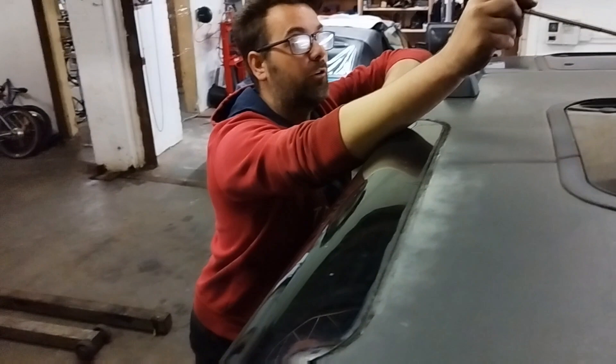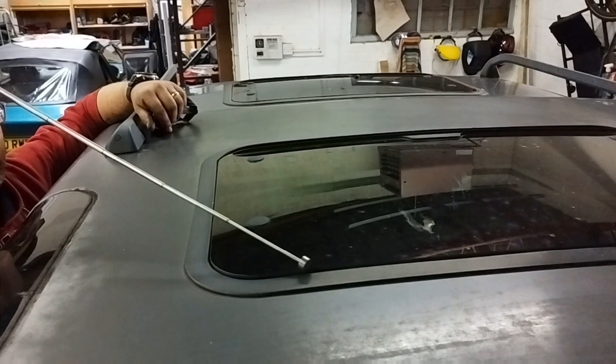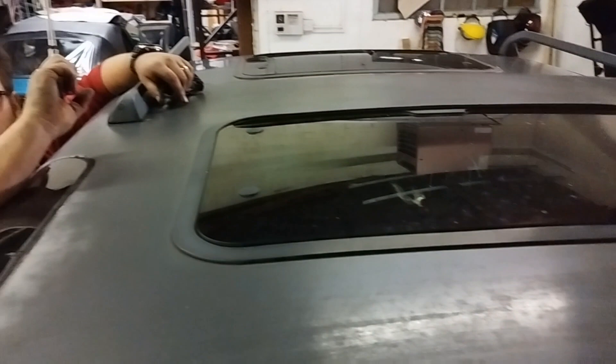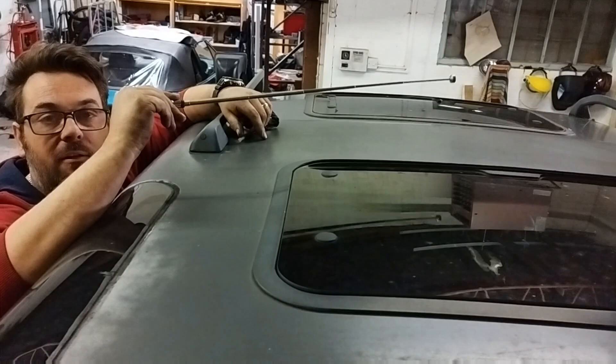If you get up on the back of the car, you can stand on the rear bumper and look at the sunroofs. Some have got two, some one, some none. Have a look around the seam where the sunroof closes and see if it's full of sealant — if it's been sealed, they've been leaking, which means the headliner's probably gone. Go inside and make sure they open and close — some will be electric, some on winders. Make sure they open and close properly.